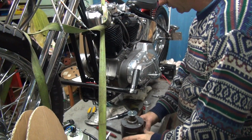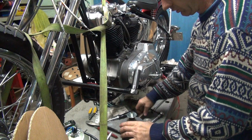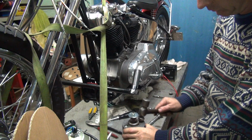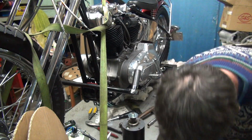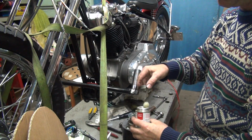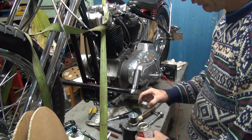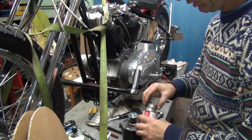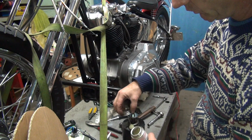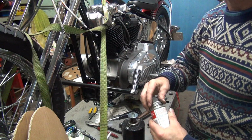Alright, we're back. Okay, just going to tighten up the one bolt. And beat the other one down on the side so it sits in there where it belongs. The gasket on the floor helps. So you beat that down in there. That engages the splines. Let me go ahead and put it back together. So instead of putting a new gasket back on, we just put some goop back on there. The gasket's torn evenly, so it'll go right back to where it came from. And the goop will reseal it. It's almost like having another gasket.